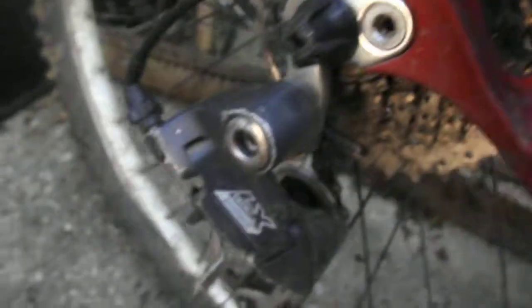I'm probably going to respray the rear end of this black, because that's in really bad condition — look at the corrosion. It's only surface, Tom said. He's a welder, he knows his stuff. He said it's only the surface and I'll get away with respraying the whole thing black. I'd have to blast the rear end of that, I'm pretty sure. It's been bodge built, to be honest. It's got an XT 9-speed rear derailleur, and that's a GT hanger, I'm pretty sure. It's very mouldy and rotten. XTR/XC front mech. I might put an XTR/XC rear mech on it as well, just so they half match. Though I do have an LX derailleur down here just on the Coyote — I might take that off and put it on this.